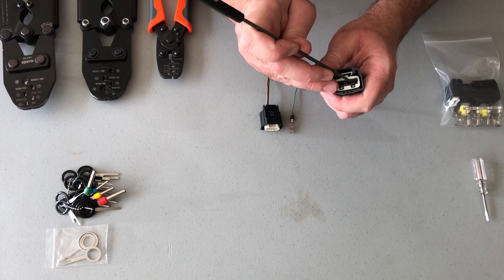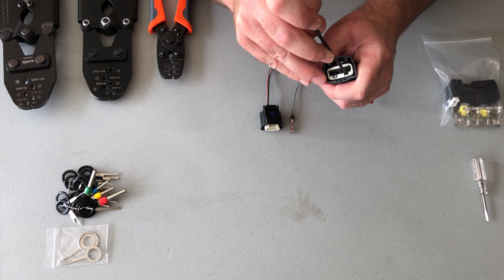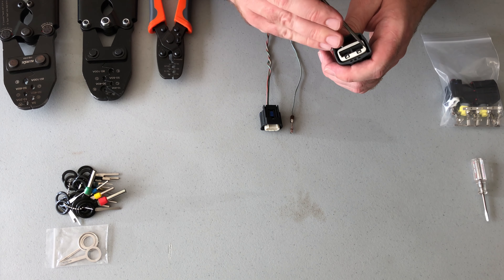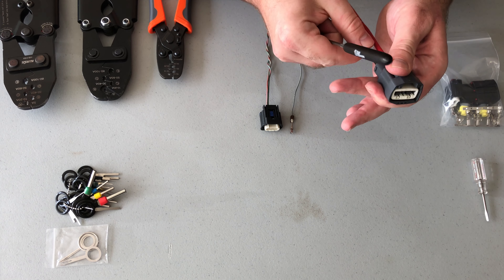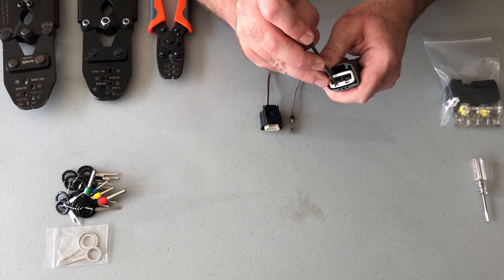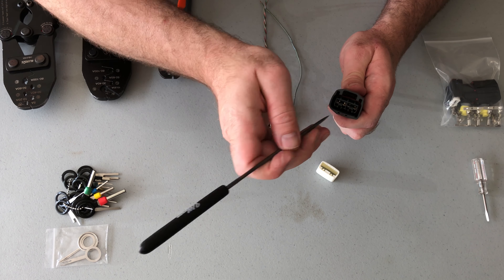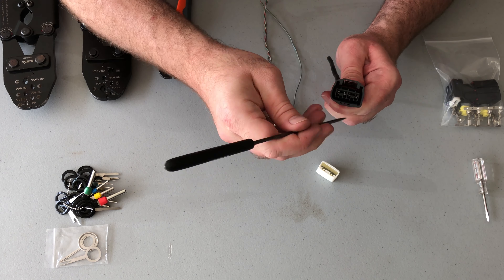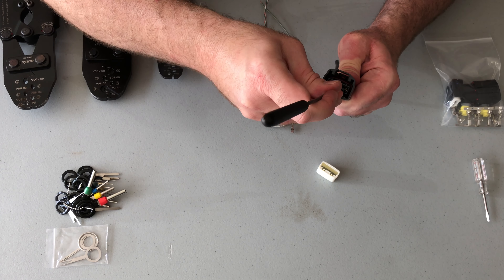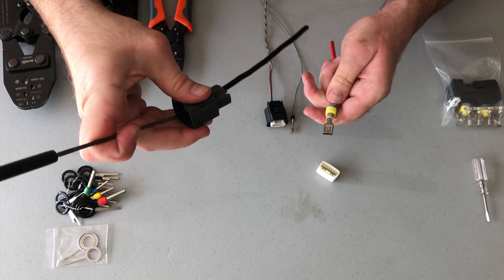To take it apart, look at the left tab here and pick that up to completely remove this. This would let you install a retainer — if this came to you snapped all the way down, this is where you'd want to put it so you could install the wires. To remove the wires, lift up on the right-hand side and the retainer comes out all the way. Each of the wires has two tabs that lock in place, so put a little bit of pressure on the wire and then reach in with a thin screwdriver or pick tool and pull those tabs out of the way so the wire can be removed.